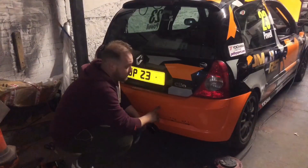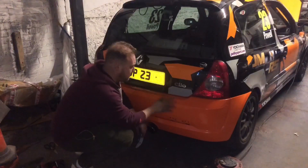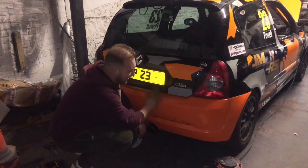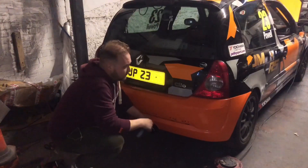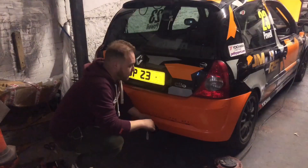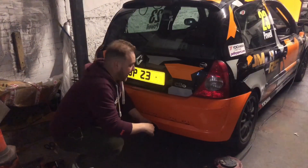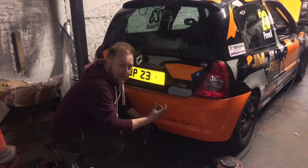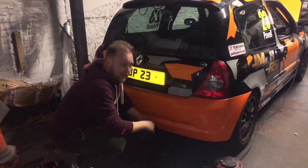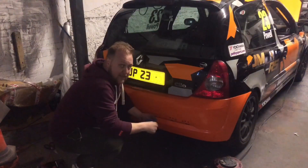Sadly, as I mentioned earlier, the finish on this rear bumper is absolutely horrendous — it's gone really orange peely and I've got loads of runs even though there were no bits coming out of the gun at all. I'm hoping I might be able to repair it using some 2000 grit wet and dry sandpaper and my dual action polisher. I'm going to give it a go — worst case scenario I repaint it. I basically should have just bought myself another air gun, completely forgot, tried to make do, and this is the result.